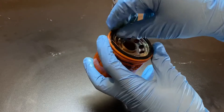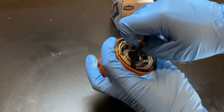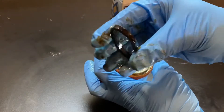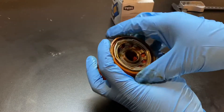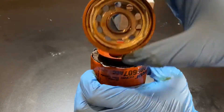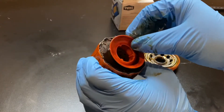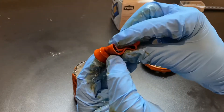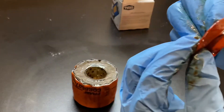There's the rubber gasket — it hasn't hardened up too much with use, so that's promising, not too bad. There's the base plate, nasty and greasy and oily, with lots of holes for the oil to get through. And here's a surprise — a silicone anti-drain back valve, and it still seems to be pretty flexible after all this use.